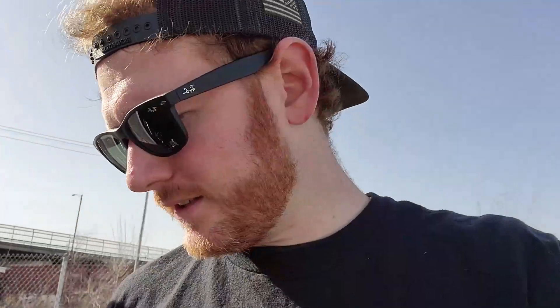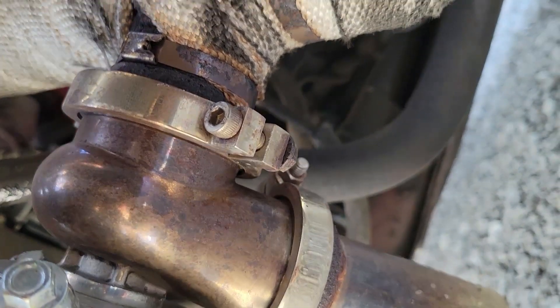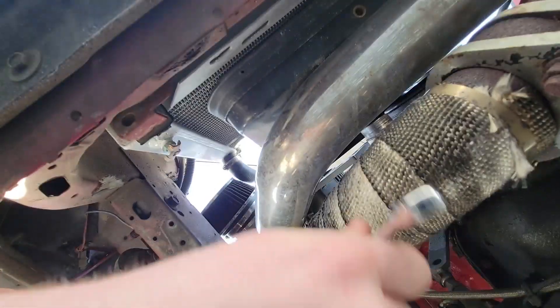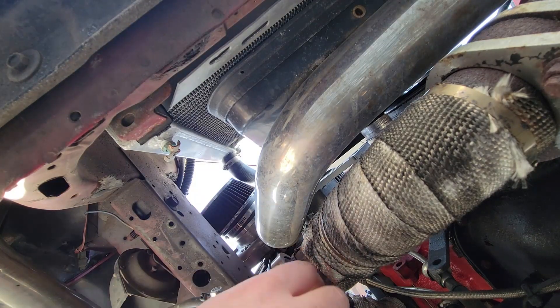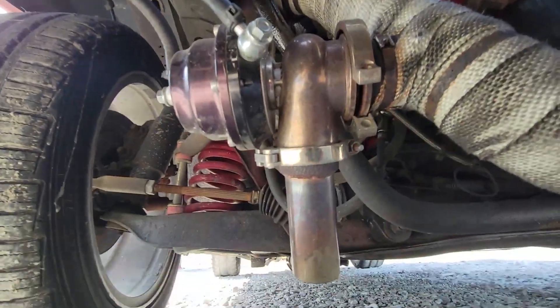Tim had to go pick up his wife, so it's just me now. We're gonna try to take this wastegate off real quick. It's just a little band clamp — why'd they use Allen bolts though? I'm gonna take those two off; one goes to this controller. Got the band clamp off, gotta take off my vacuum lines and then she's out. All right, let's go rob it from the old Rambler.